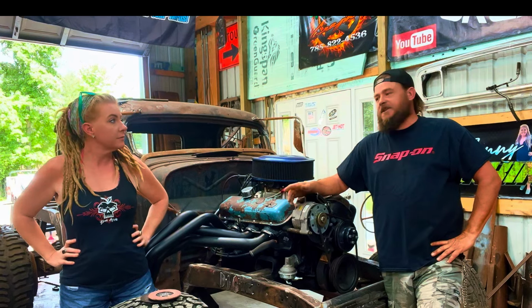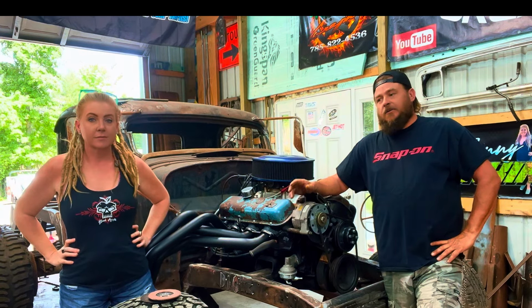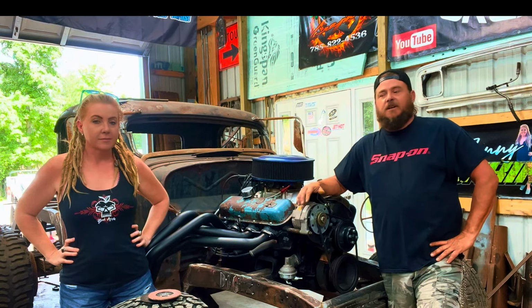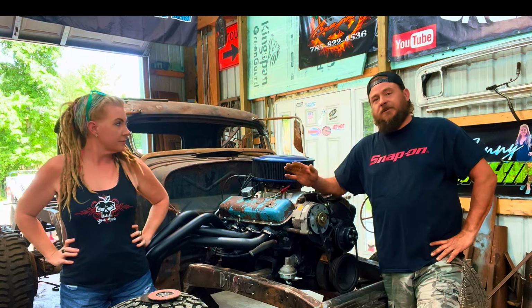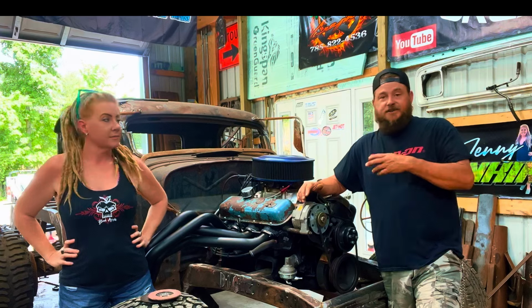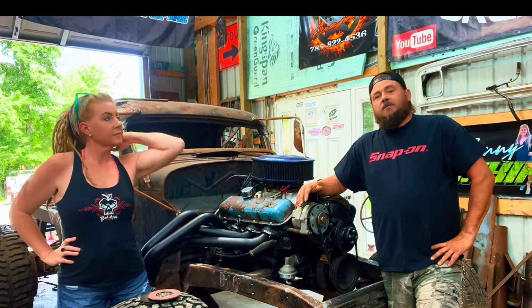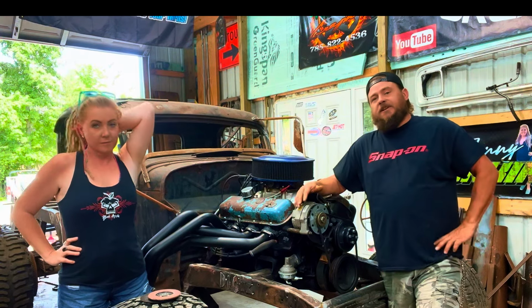He's supposed to be ordering a wiring harness to have sit here. And when I get it back on the lift, I'm going to do a little hillbilly dial indicator engineering on that drive shaft, because I kind of just put it in there. We took it for a drive. I wanted to see if it's out of balance or what, instead of just saying, here you go, it's fixed, and three drives later it'd throw the rear U-joint out. But we know that it wasn't the clutch and we didn't need to tear into it. It drove great.